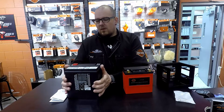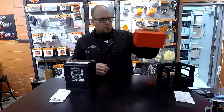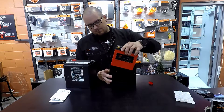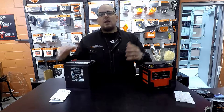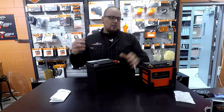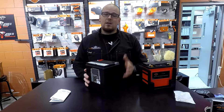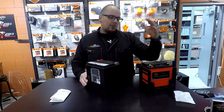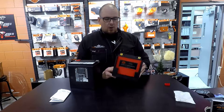There are three different battery sizes: touring, Softails/Dynas/mid-size bikes, and Sportsters. The standard AGM touring battery sits at around 21 pounds — this lithium-ion is 3.34 pounds plus the cradle, so between three and a half to four pounds total. Mid-class cruiser batteries weigh 15 pounds versus 2.8 pounds for lithium-ion, and Sportster AGM batteries are 11 pounds versus 2.2 pounds for lithium-ion.